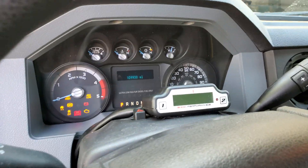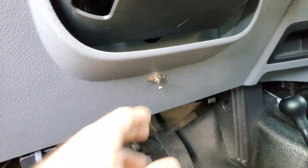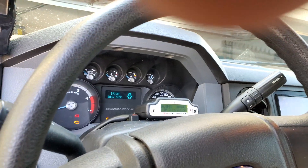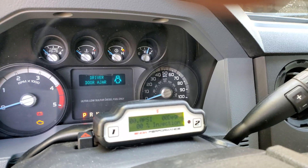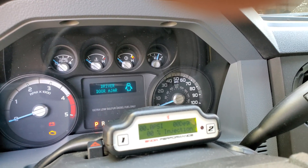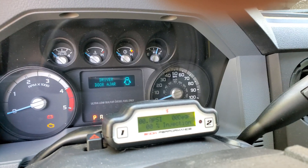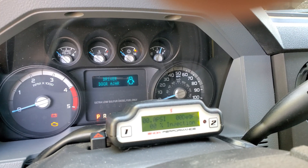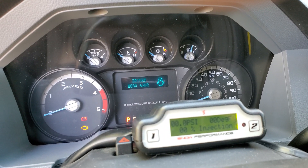Keys on. Normally this would turn on with the key, but Snow recommends a toggle switch. If I leave the switch on it'll come on with the vehicle every time. I did have it turned off just for some testing and just flipped it back on — otherwise it's on a relay so anytime the keys turn on, it comes on.